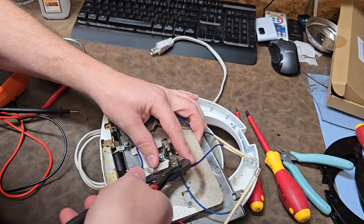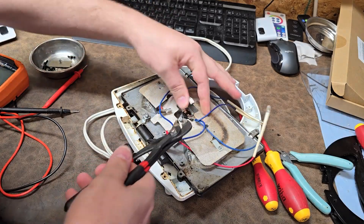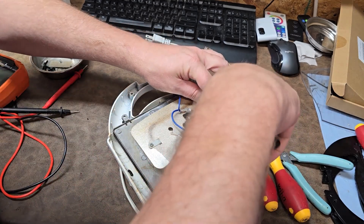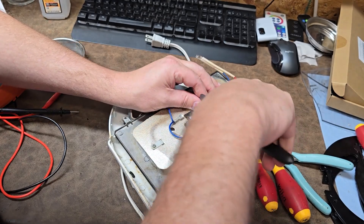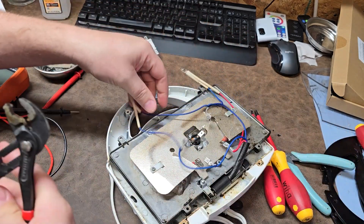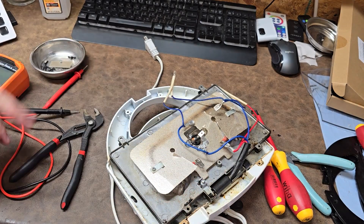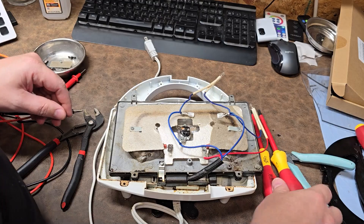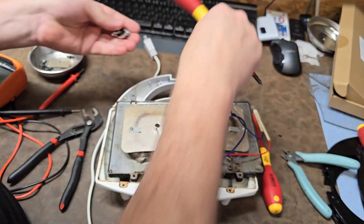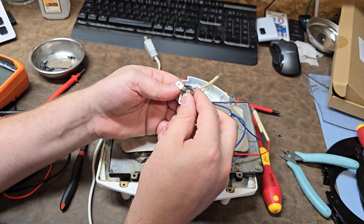Let's pull this one off as well - don't be afraid to take these apart folks, it's already broke. It's got that little thing; this one is really held on good. Okay, I can replace him. This is a little bit of heat shielding. Right here is the component in question - not the thermal fuse, but this is my disconnector; it keeps my temperature in check. It reads 150 degrees C, 10 amp, 250 volt. This guy is definitely obtainable - that's a KSD301, piece of cake, easy to get.